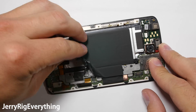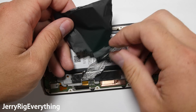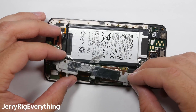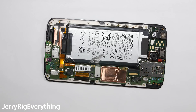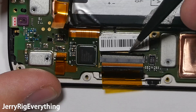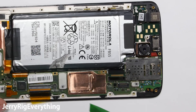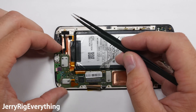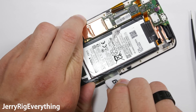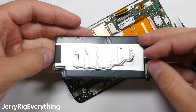There's some black tape over the battery. Remove it and set it aside — try to keep it in one piece so you can reuse it later, but if it gets torn it's not a big deal. This stuff is not meant to come off easy. There are two screws holding on this metal bracket. It's a fantastic idea — it sandwiches the motherboard between two pieces of metal, making the phone way more rigid. I'm going to unclip the battery. Then there's a piece of gold tape over this ribbon cable connector. I'm going to unlatch the end of it to unlock the ribbon so it can be pulled away from the motherboard. This next one is more like a Lego — I'll unsnap it from the main board. There's also a little extension microphone ribbon at the bottom. I'm removing the battery using my metal pry tool, taking very special care not to puncture or slice the battery. It is very important that you do not puncture the battery during this process. A little bit of heat would help, but the battery just pops out on its own.